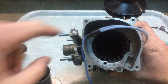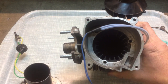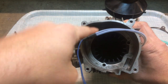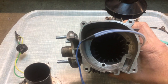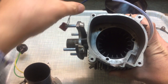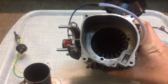Around this face here, that's where the gasket goes. When I removed the gasket, it fell apart so I've had to clean that up very carefully. I used a flat head screwdriver and scraped it backwards along. It's really important that you don't gouge it, because otherwise you'll end up with exhaust gases squeezing between the gasket and the housing — and you don't want those coming out into the van, which is obviously quite dangerous. So I've cleaned that surface and also this surface up here, getting all the way around and removing all deposits of the old gasket.